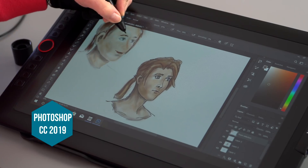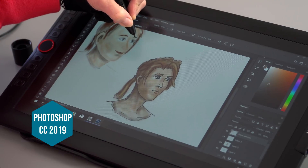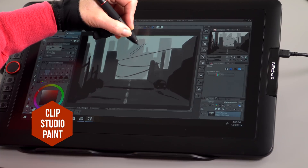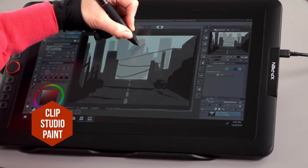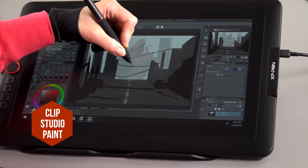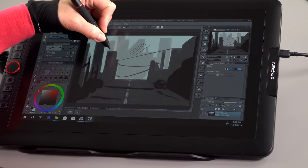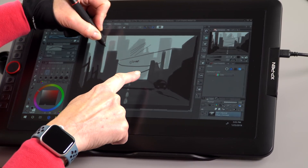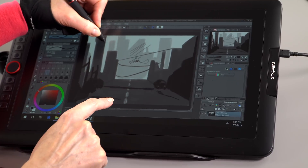In terms of testing as an artist, I tested this with Adobe Photoshop CC 2019, Corel Painter 2019, and Clip Studio Paint — it was compatible with all of them. The only thing I found with Clip Studio Paint, which isn't surprising, is you definitely want to use the Tablet PC input. If you try to use the Wintab input, your input is off by about three inches to one side, so don't do that.